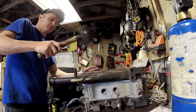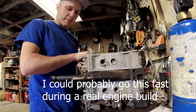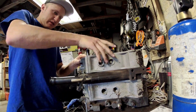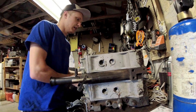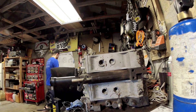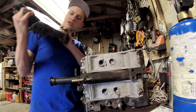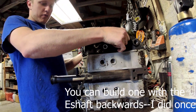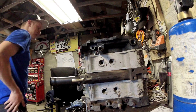Make sure the corners didn't pop out. Tap it down. Grab the next housing, slap that baby on there, make sure it's good and sealed. Put the dowels in — nailed it, first try. Then slide this one down in there. Before you put your rear plate on, make sure that your corners haven't popped off your rotor, your coolant seals are still in there, and your e-shaft is in the right direction. Put them on there — done. Easy peasy.